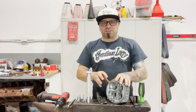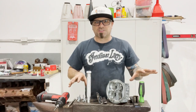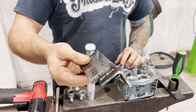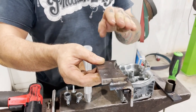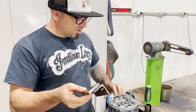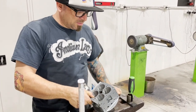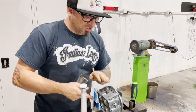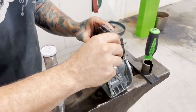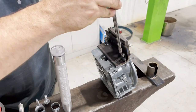I'll show you how I screw this to the carburetor body and then point out what we've got and how it works. This is our main body — everything gets jigged up off this. I've got a nice machined surface with bolts where the metering plate and fuel bowl mount, so this will bolt straight up like so. Let's screw that on nice and firm.